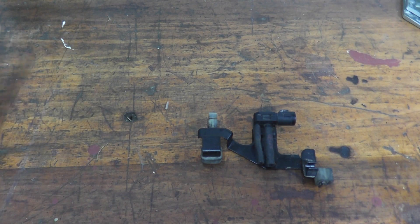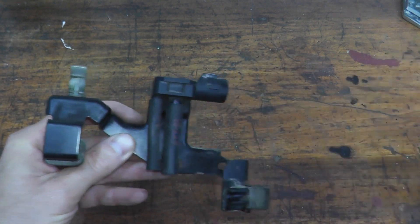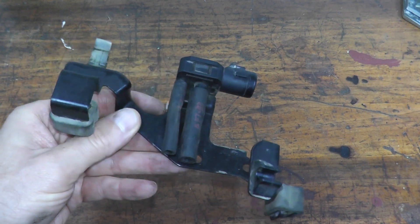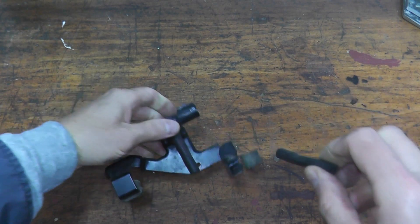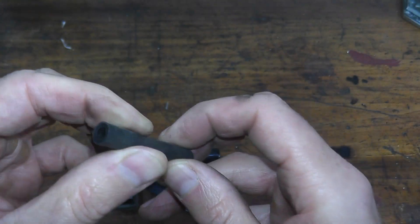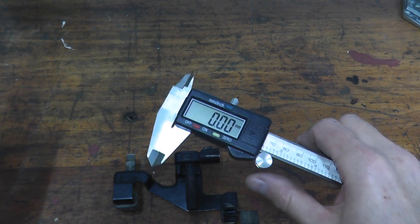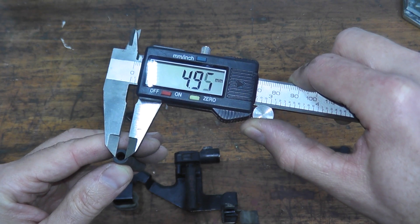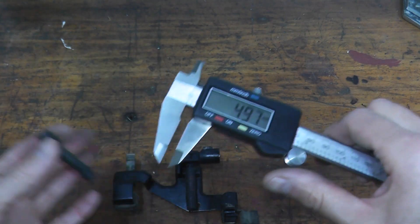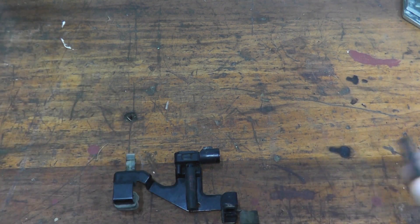Now we can place this assembly to the side and just focus on the pressure sensor. First, you want to check the hoses — this could be perfectly fine, or you could just have a ripped hose. In this case, the car is 21 years old and the check engine light is not on; I'm just doing this as a how-to. But looking at the bottom, you can see some cracking, so I'm going to replace this hosing. If you want to order the correct size online, use a digital caliper — this one measures roughly 5 millimeters, which is about 3/16 of an inch. Order a foot online and you're ready to go.